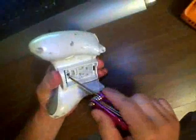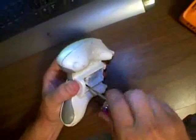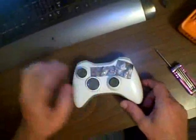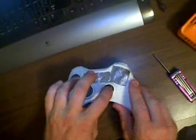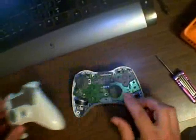Anyways, the screws underneath, I already took out 6, so I'm taking out the final 7th. It takes a Torx number 9 security, and I bought this tool at Harbor Freight. It's about $5. So anyways, now with all 7 screws out, you're going to pull off the top cover. It should just lift right off. I put my fingers on these gray buttons to keep the board down.